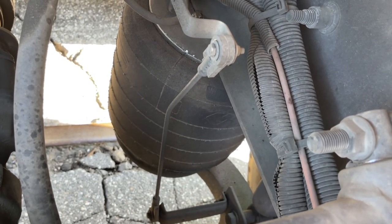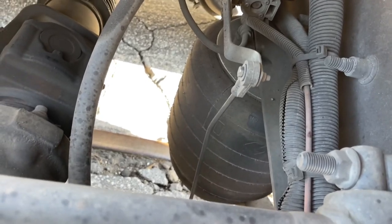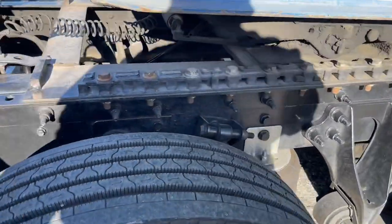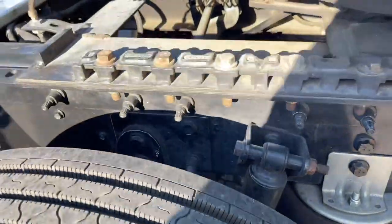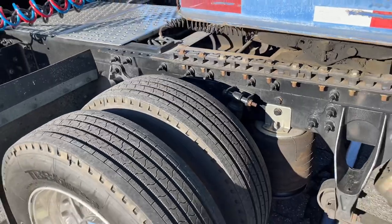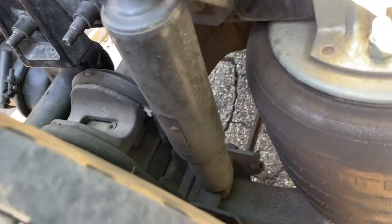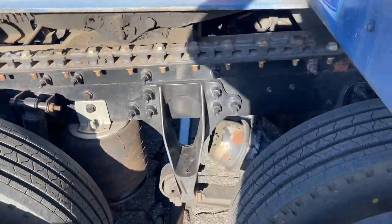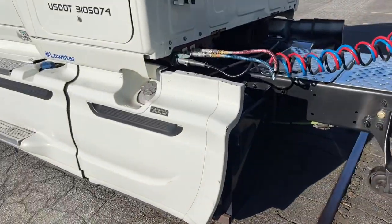Over here in the rear — I lowered it by bending this rod. I grabbed it in the middle, kind of toward the edge, and at the bottom I got a good grip with both hands and kept putting a bend in it. Then I'd come back up and check while the truck was aired up. This piece right here used to sit up about here — the International sits really high and it was raked badly, the front end so low and the back so high it looked stupid. That brought it down about two inches in the rear, using the factory shocks which still have plenty of travel.